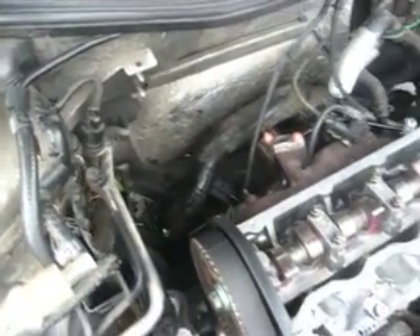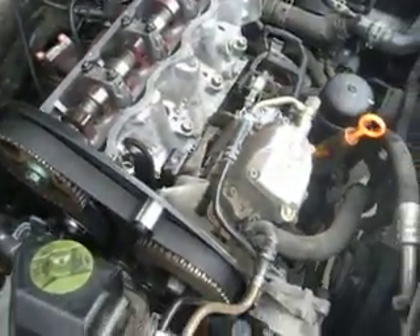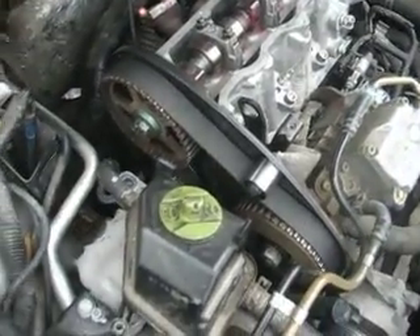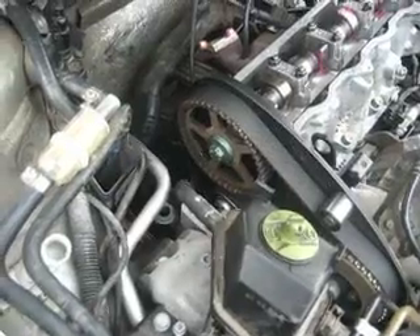All you need is your outer horn and you need your VNTs from inside. So since you have it open already, you can go ahead and clean it. That doesn't come with an actuator, and it doesn't come with the outer horn or the flute for the intake side. You guys got any questions? I'm damn near an expert now. There's always more to learn about Volkswagens. Love to drive them, and they're not too bad to work on — you just got to be ready. And don't work in the freaking cold out in the snow when it's 12 degrees. Take care, bye-bye.